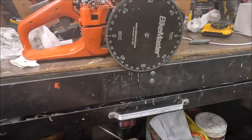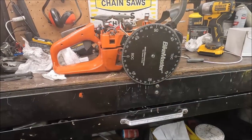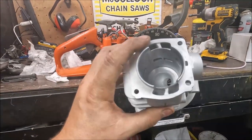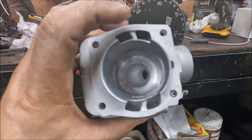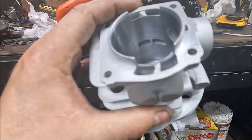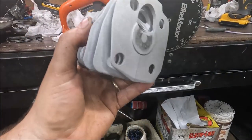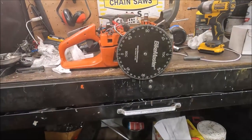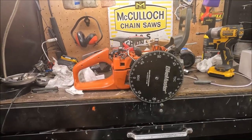On the exhaust we'll have to move it back a little ways, not much. I've got some numbers in my head I think will work, and I think it'll be just fine. As far as the transfers, there's at least a little bit of lip here kind of like a 372 but not as bad. We'll pull that down, unshroud them a little bit, do some texture work, then we'll be moving the uppers back some and changing the angle on them. Hopefully the next video we get into actual port work, and then it's kind of all downhill from there — it won't take more than 15 or 20 minutes to put it back together.